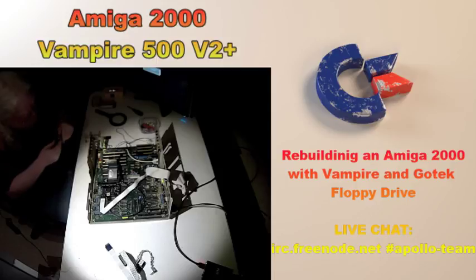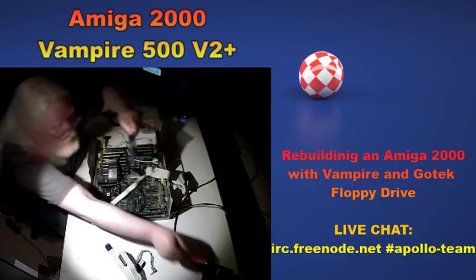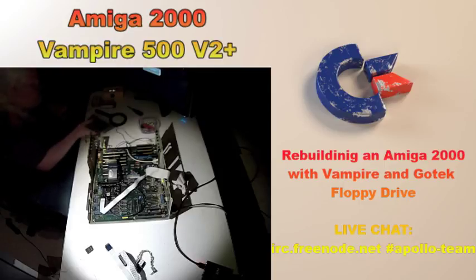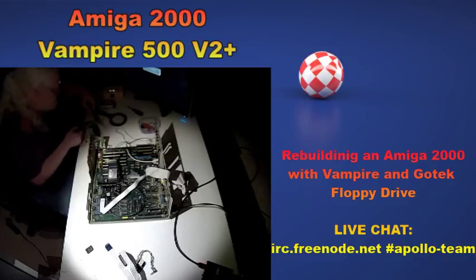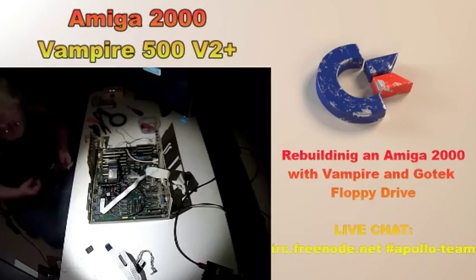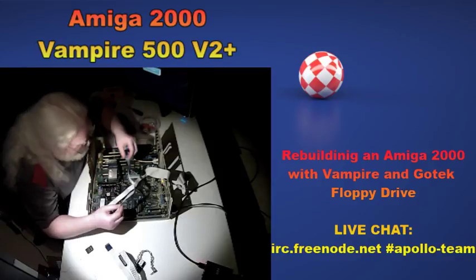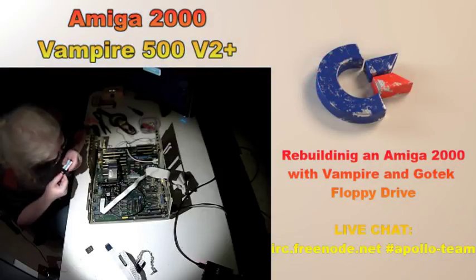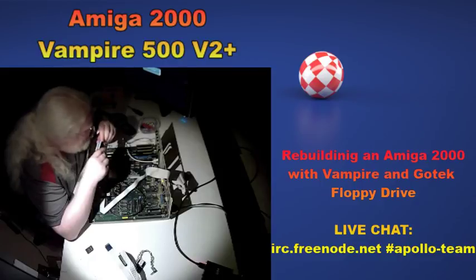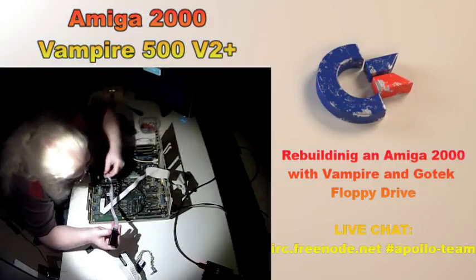So let me grab these scissors and continue. And we will install the USB blaster, which, unsurprisingly, comes in several parts. So, here's what you have. You have the USB blaster portion, which is this portion, and it's called USB blaster. It's for Altera. And we definitely have a port on our Vampire for the connection of an Altera USB blaster. It exists right there. There's no way to accidentally connect that backwards because they are keyed.